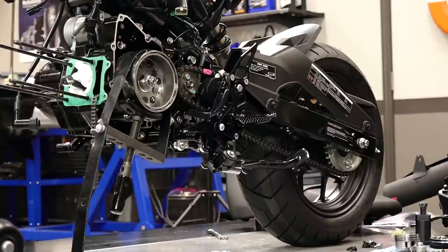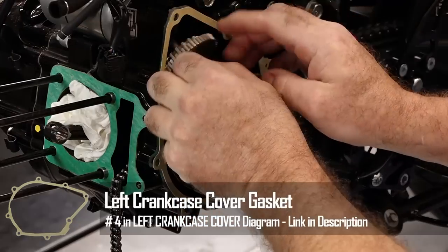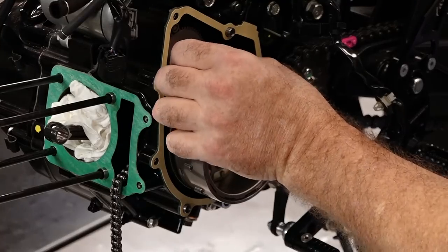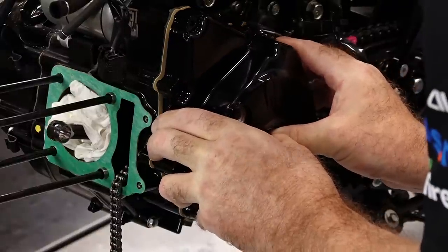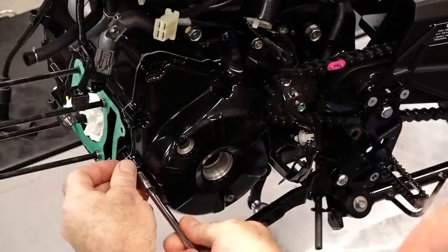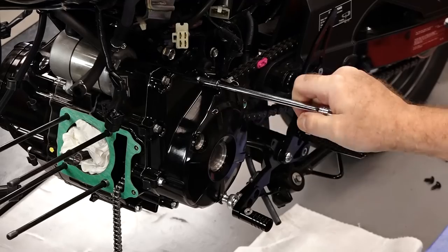The surfaces look good and clean, I don't see any oil that needs to be wiped off. Go ahead and get our gasket in place over both of our dowels. Let's get our gear back in and get her lined back up. Don't forget the spacer from the outside. Now we can get our stator bolted back up. Remember you had a couple of wire holders — two on the front and then there's one in the back that actually has two holes in it. It's a low torque value on all these, around 7.5 to 8 foot-pounds — that's all you would need.